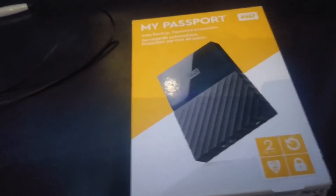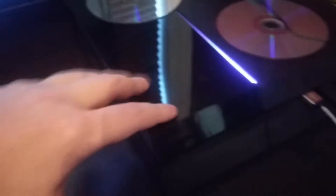So if you were to take it out and go to the Pro with it — say you have a two terabyte hard drive and the Pro comes with a one terabyte — when you go to put it into your PS4 Pro, your new system, it will make you go back through the whole entire formatting process where you have to restart the device, and it will wipe everything that you had on there.